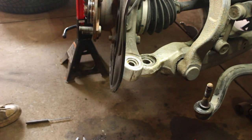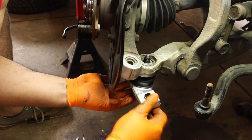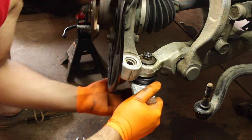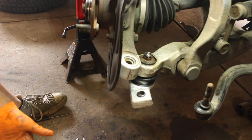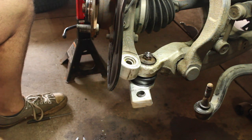I just took a wire brush and got the inside of the nut cleaned out. Now we're going to go in here and put that on there — it goes on a lot easier now. We're going to tighten it up. We want to make sure we don't have movement. There we go, it's getting tight. We've got no movement. So now we need to take the whole steering knuckle and lift it up over this and fit it down in.